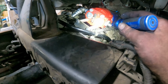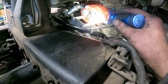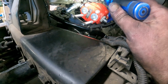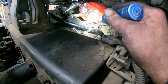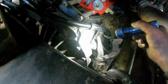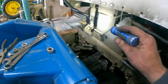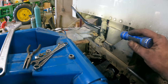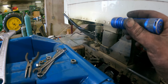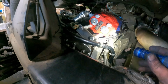I've got my transmission dipstick tube relocated. It did go underneath that pump, and then it went up through to the front side there, if you recall. And it was kind of hidden behind a cluster of air hoses. So I made up a bracket right here to hold the bottom side of the tube, and then I've got a piece of 1/4 inch by 2 flat bar running up the side, and we've got it right in behind the cab. Easy access, a lot easier access than running it behind or up in behind the engine there.